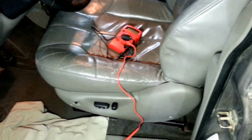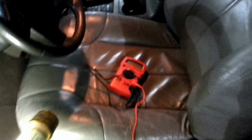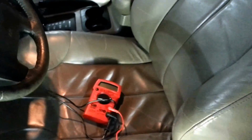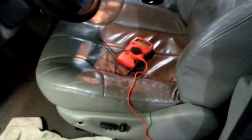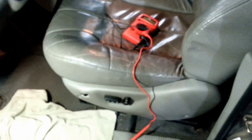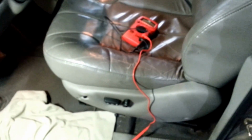I looked at a number of different websites that sell replacement parts. Basically, it's a square inlay pad with maybe some side pieces, but then you have to get in even further, and I just didn't want to mess with those D-rings in there. So we'll try this first and see how that works, and hopefully it does. Helps to have a good multimeter to be able to check continuity on those wires in case your break wasn't as obvious as mine. Mine was pretty obvious. It had a burn through.